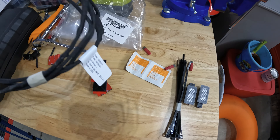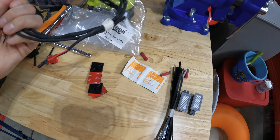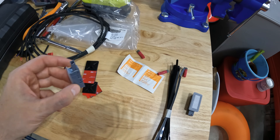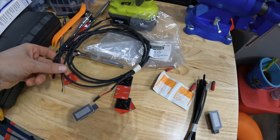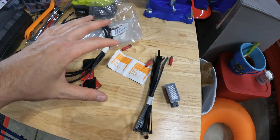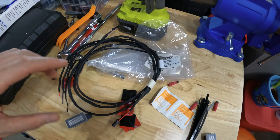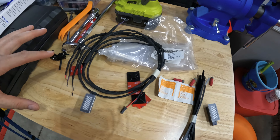So I'm going to go on some forums and posts that I've seen. Here's what you get: you have a harness, and you're going to be plugging in or tapping in on the passenger side. You're going to route this cord underneath your center console to your passenger footwell, install these little RGB lights that snap in, and plug connects for both sides. You'll have to tap into a connector underneath the passenger side to provide power and spectrum signal to both sides. We'll give you a quick tour of what's underneath the dash and then hopefully successfully install this.